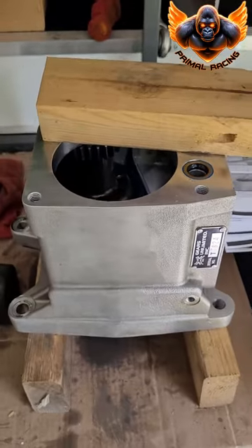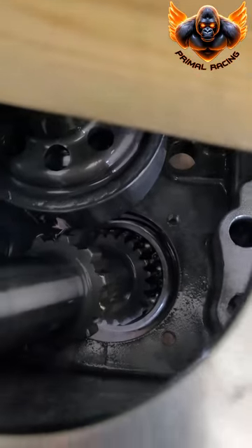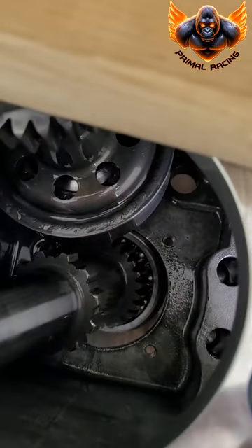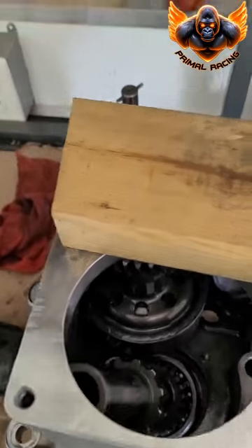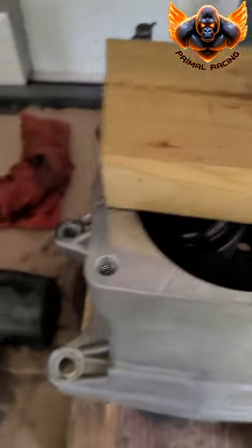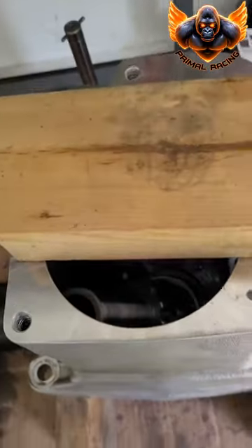There's always a point when you're doing something yourself where you come across the hardest part, and so far this has been it. This is the main shaft — it's basically pressed in, because when you're assembling it you hammer it in, so it's a tight fit. It's pressed into the case and doesn't want to come out easily, and you don't want to damage it. I just blocked it up on 2x4s, put a 2x4 on the end, tried a rubber mallet, but it doesn't hit hard enough, so I was really careful and used a three-pound small hammer and was able to get it out.